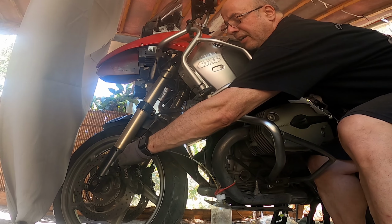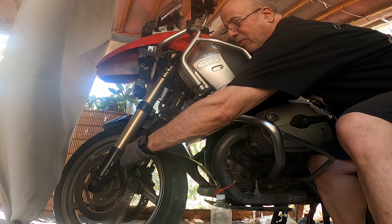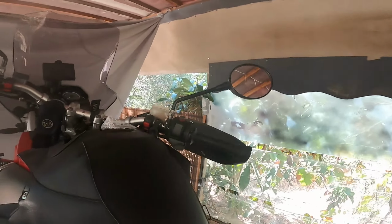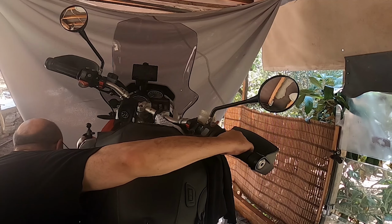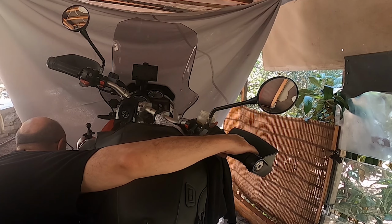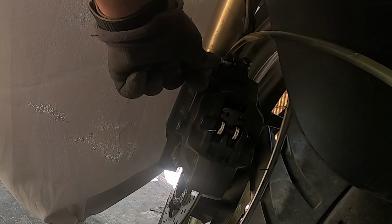You see, I opened about 1/8 of an inch, and now it was 1/16 or 3 millimeters. And of course I keep the brake compressed completely. Let me put the camera in different positions so you can see it a little bit better. First I'm going to put it here so you can see how I press that. I try not to go all the way to the end. I stop right there, you see? I stop about 1/2 inch before the end. That's the trick, not to get air bubbles from this position here, how I open it. I'm pressing now, little bit, little bit, little bit.